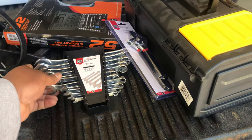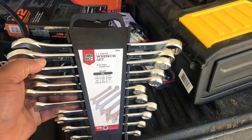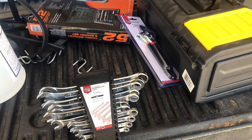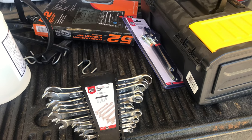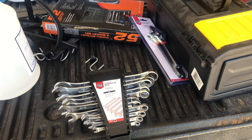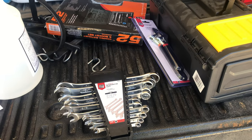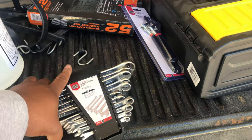Here are some open-face wrenches. Probably the most important one in this group is the 9/16. That's the size of your slack adjusters. If your brakes get out of adjustment — say DOT stops you and tells you that you got two brakes out of adjustment, but if you adjust at least one you can go on ahead — you need a 9/16 to adjust those slack adjusters. Any truck driver worth his salt knows that 9/16. I've got all the open-face sizes because they fit various needs.